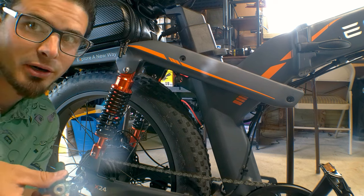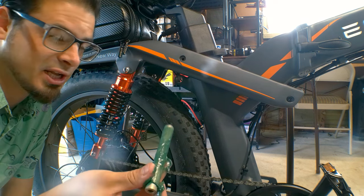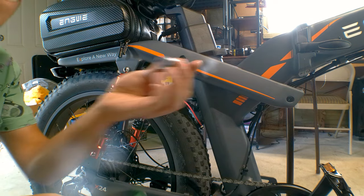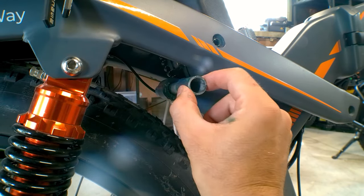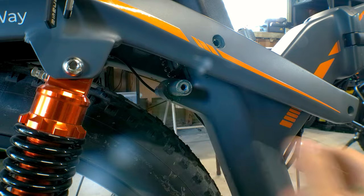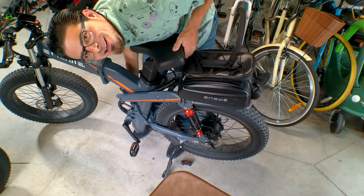Up at the hinges, I've got this kind of taken apart as you can see. There is a removable cross pin on here — I greased the bejesus out of it because it's completely dry, and I assume that will help if everything can rotate a little bit better. It's also got these little shims. I thought they were all pinned and molded into the frame, but they're not — it's just kind of a little crossbar that goes through there and bolts to here as a hinge. Oh gosh, that's way smoother with a little bit of grease.